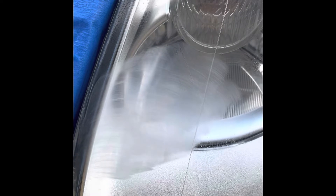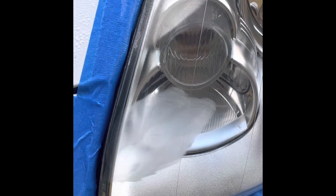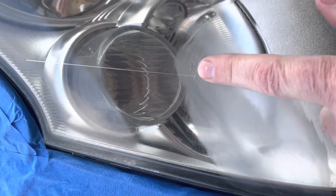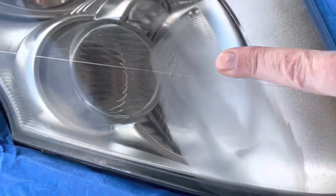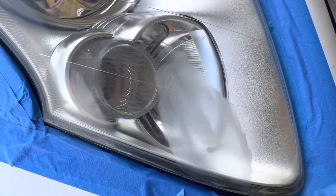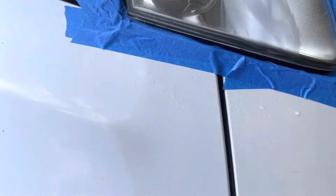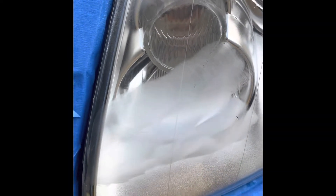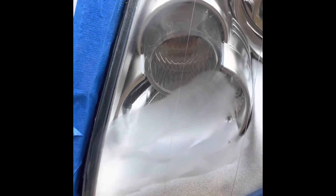This is after the 320 and now going to 800. The pliability of this paint is just horrible - I'll probably have to redo it. At 800 grit it's starting to do that distorting thing again, which is really frustrating. I'll do it all the way through and then go back and hit that spot again. It's just cheap paint - I've always tried to stay away from Rust-Oleum stuff but I'm paying for it now. That one spot may be able to come out so I'm happy with that part. I'm just gonna go to 3000 now.